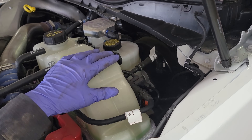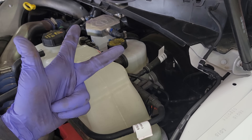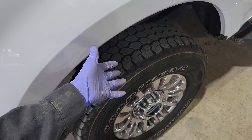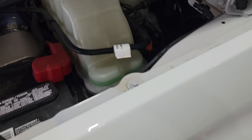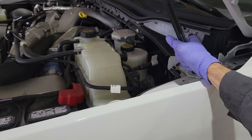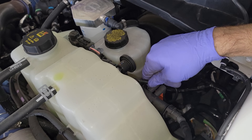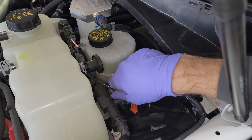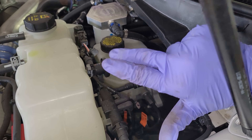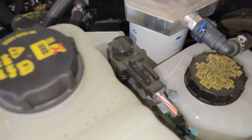There are multiple reasons why your 4x4 could not work — you could have an electrical problem with the axle switch, the transfer case control module, or the shift motor on the transfer case; or you could have a vacuum issue, which is what I was illustrating today using the vacuum gauge. Let me know in the comments how you are checking your 4x4 — whether using a vacuum pump like I did here or some other method. Remember to like, comment, subscribe, and share, and I'll catch you guys next time, probably underneath the hood of a Super Duty.